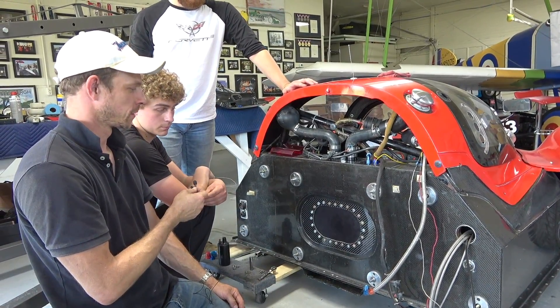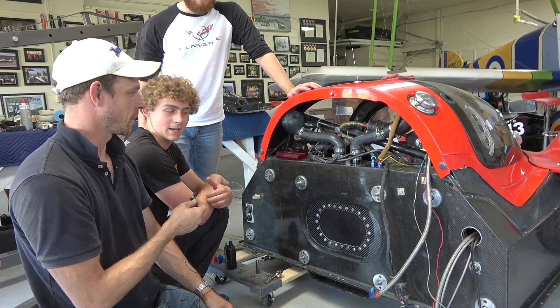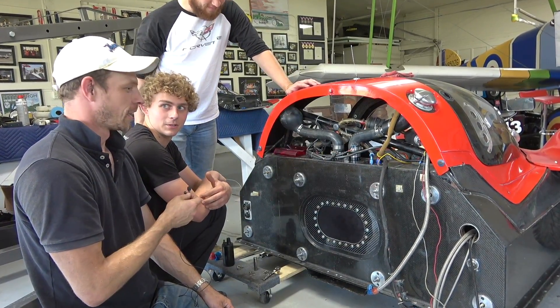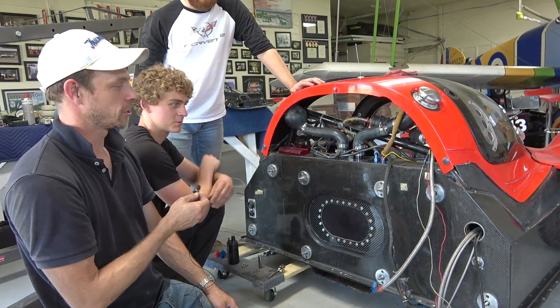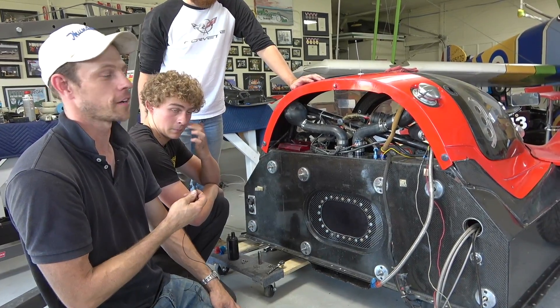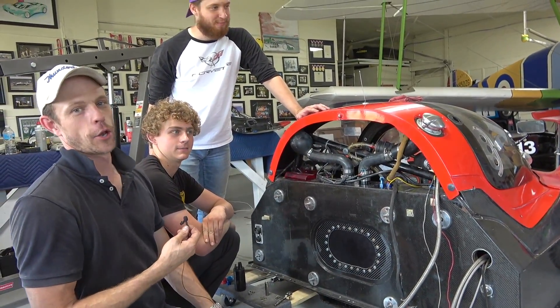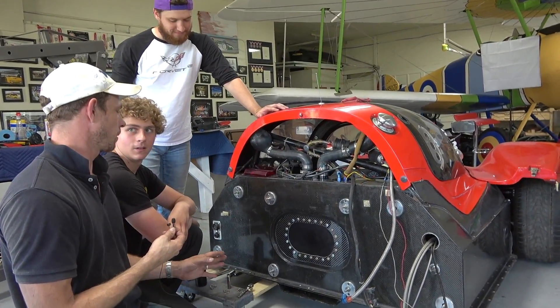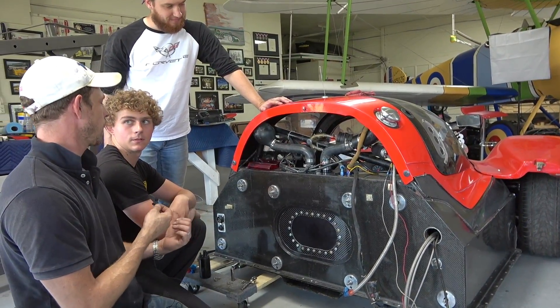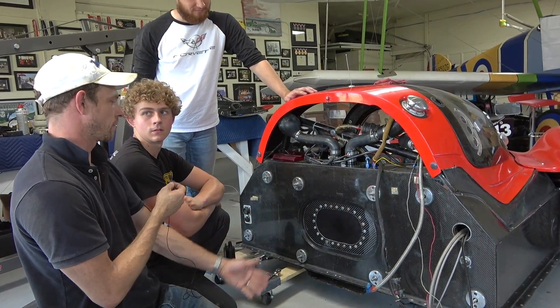The old one was probably from the early nineties and did not hold fuel anymore — it had crumbled. It was quite the mess getting it out. When I made the deal to purchase this car for Genius Garage, I asked them specifically to put fuel in — I want to know if the bladder is okay. They said yes, but nope, they did not do that. So we got a new fuel bladder made at FuelSafe; you had to do all the measurements and engineering drawings and go back and forth with them.